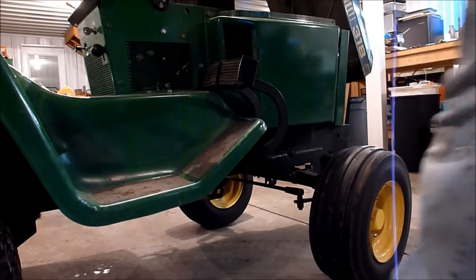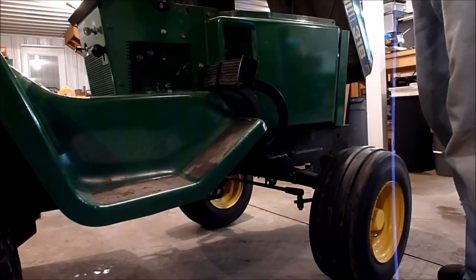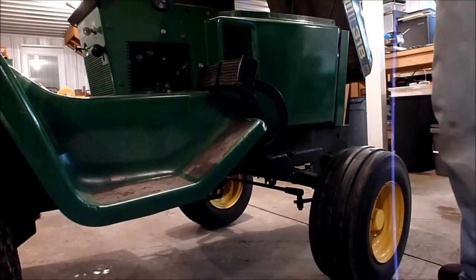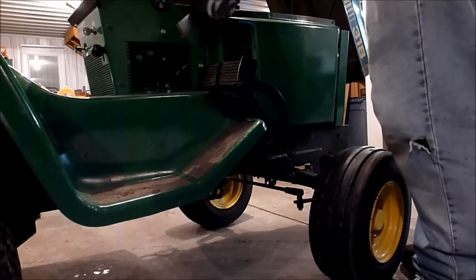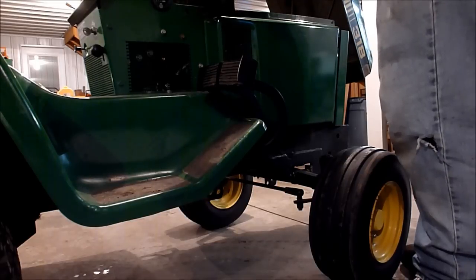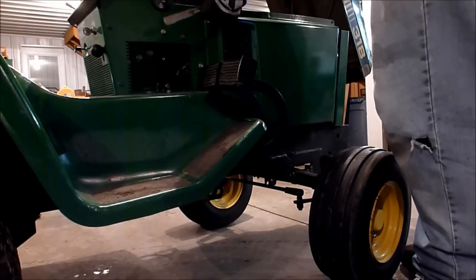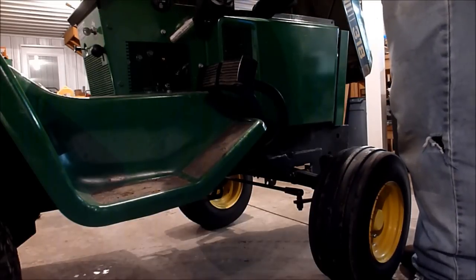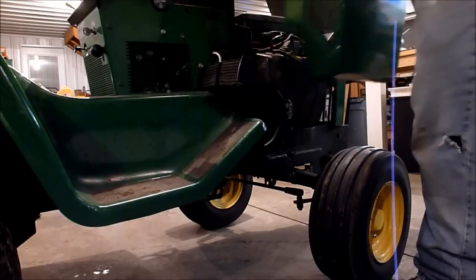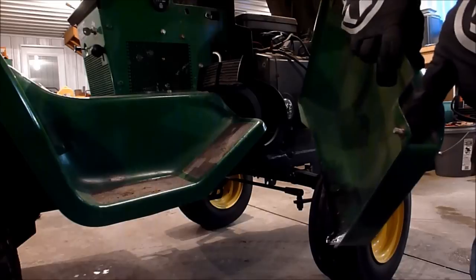Alright, I think I did one of these videos a while back, but it wasn't very good. I don't even know if I posted it on YouTube, can't remember. Changing oil on a 318 is pretty daggum simple. You just pull, this bolt right here should be a 10 millimeter bolt. Just pull it out. A lot of times those are changed out for either a 7/16 head or a 1/2 inch or something. And then really you should just be able to pull the panel right off. This bolt should stay in because it's kept in there.